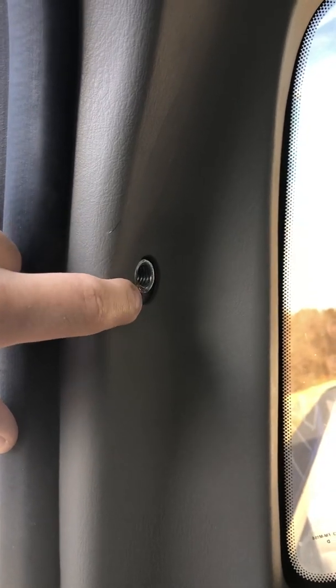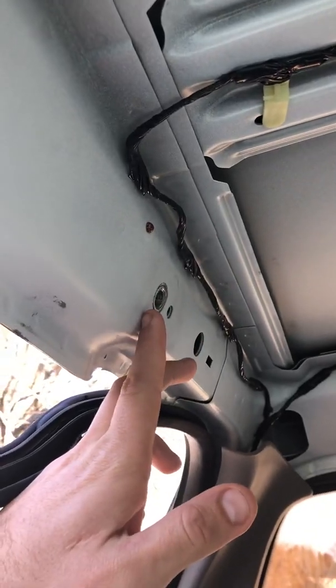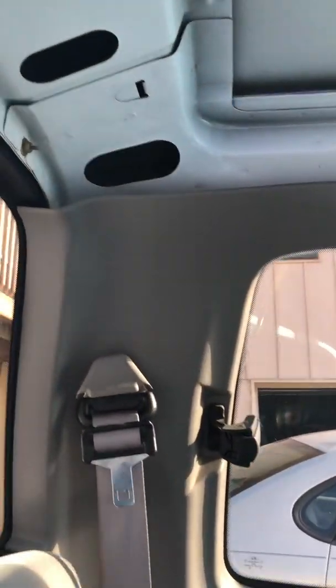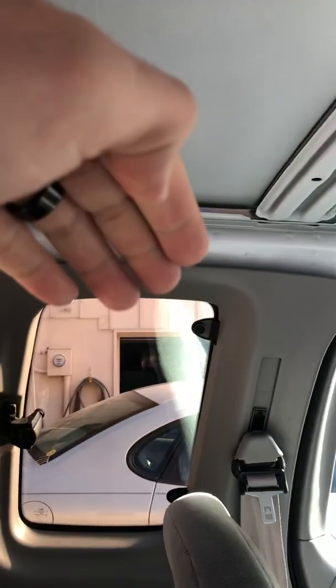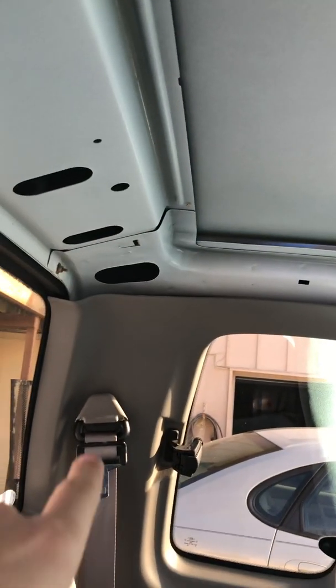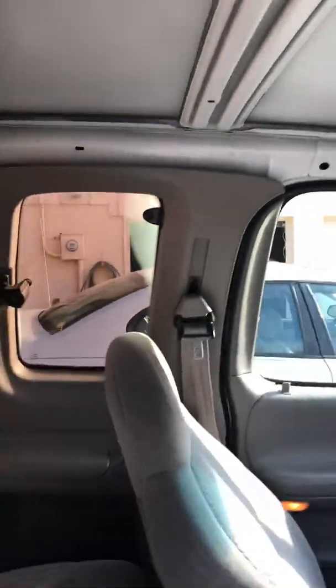So you need to take your rear seat belt off and your front seat belt, which goes right up there. And that's with a Torx 55 bit. Torx 50, sorry. Same thing over here. I just pulled the plastic pieces off to free the headliner. I didn't take that seatbelt out; I lowered this one all the way to give me a little bit more play. So now you've got all 4 corners freed up.